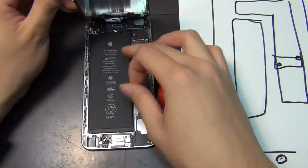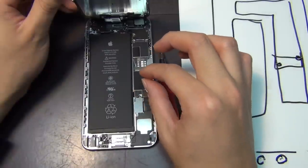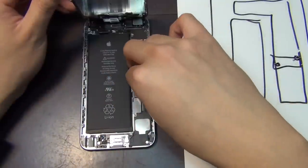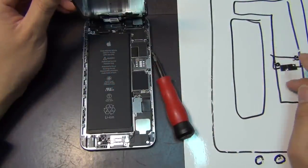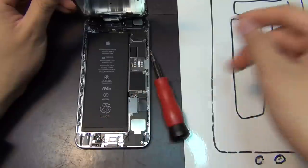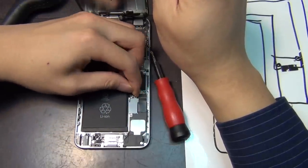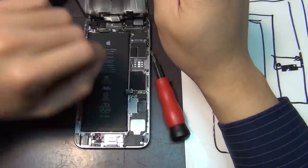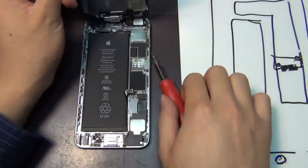You don't need to worry about touching anything once the battery is off and you're discharged. The ESD shield doesn't really do anything once you have no static charge on you. This screw is always hard to get to — you can use a tweezer if that's an issue. Once you do that you can peel this open and place it onto your pro mat. Use your fingernails — if you watch my videos you'll notice I don't use a pry tool to open any of the FPC connectors. It's terrible for them. Use your fingernails.